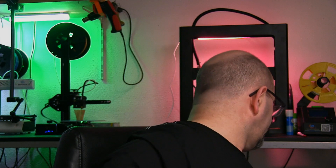Would I use it myself and recommend it? I'm not sure for every case. I tried it on my JG Aurora printer and it was a pain — that printer has a glass bed with a diamond surface, similar to the Anycubic i3 Mega's ultra base bed. If you have a print bed like that, don't bother using this material because you can't clean it off afterwards. But for build tak, fake build tak, glass, or plain aluminum, definitely try it — it really helps with adhesion and you won't have warped prints anymore.